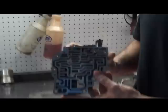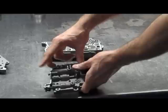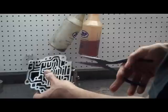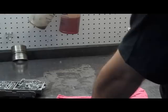We're starting with the end clutch control valve, and this is kind of a little tricky to get out. There's a little pin that retains it. What you have to do is turn the valve body over and kind of press on the end plug a bit, and kind of vibrate the pin out - you'll hear it fall. After the retainer and pin come out, there's going to be another piece in here - it's kind of like a spring seat. You're going to have to grab that with needle nose pliers and kind of walk that out. Underneath here is your end clutch control spring.